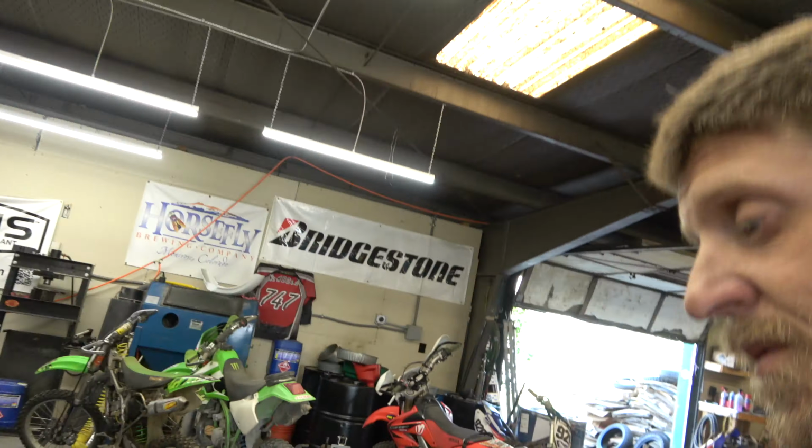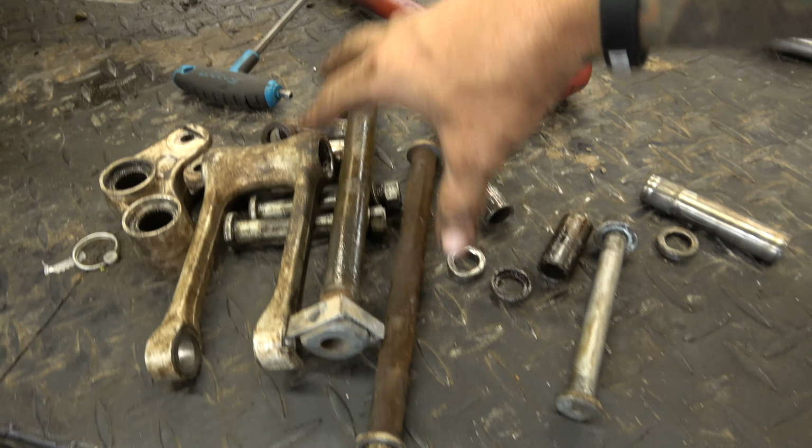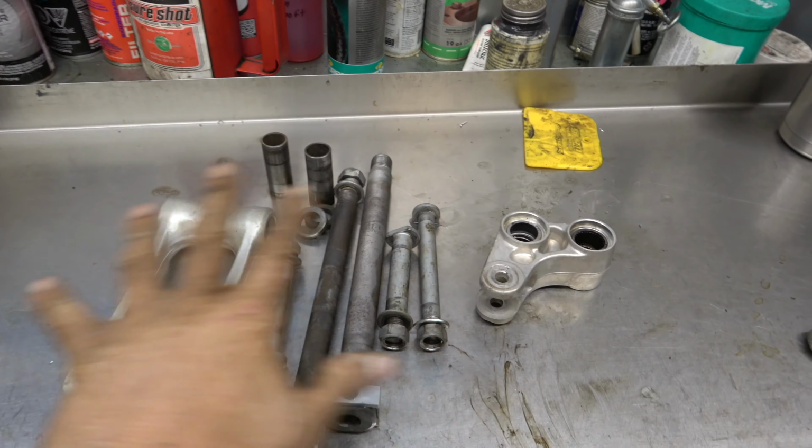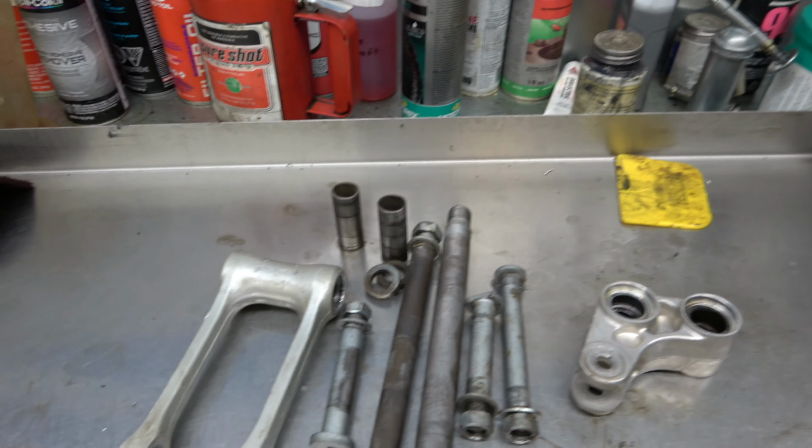So anyway, in that ultrasonic is going Fabuloso and water. It's a 10 liter deal. I put probably 2 cups of Fabuloso in with the 10 liters of water, get it nice and hot, 60 degrees Celsius. Run for 45 minutes, and yeah, let's take a look at what we got here. There's that beforehand. Got them all cleaned up. That is a much happier view than before.